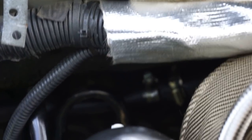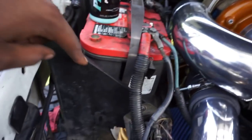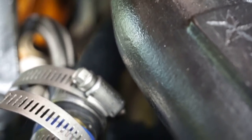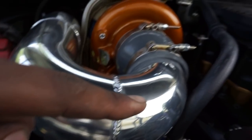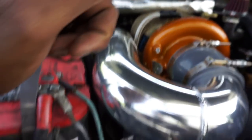You guys can see that coolant line in there. Okay, I got that going all the way around. You can see where it goes around. It goes underneath the battery and then down underneath, and then eventually, I know it's crazy. Y'all gotta stick with me. Eventually, it leads right there. It's I believe a 3/4, if not 5/8 heater hose, and you just clamp it there, route it, get you a coupling, and connect it there, and you're good.